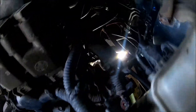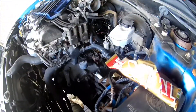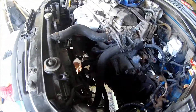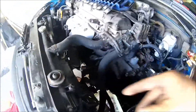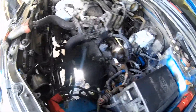Quick break — got a lot more done. I think all the axles are out, the bottom bolts are out, just got to get the starter and pull this plastic stuff off. There's plastic in here, it's got boots on top, and then a mount, and the transmission should come out. Alright, starter's out, all that's done.